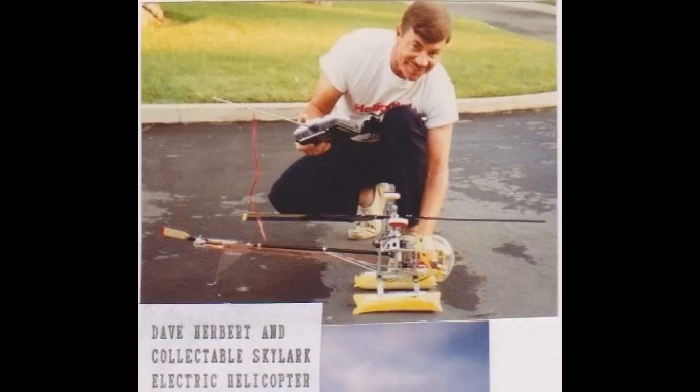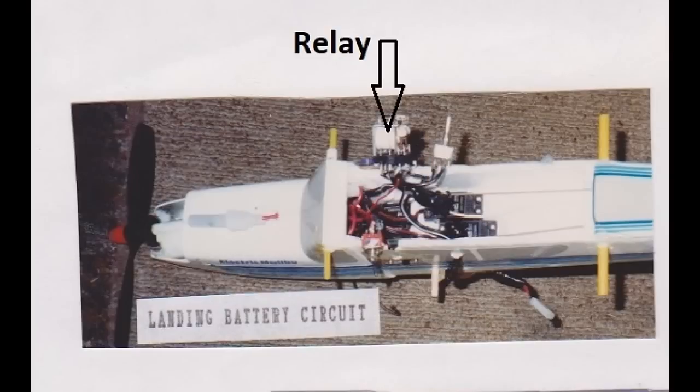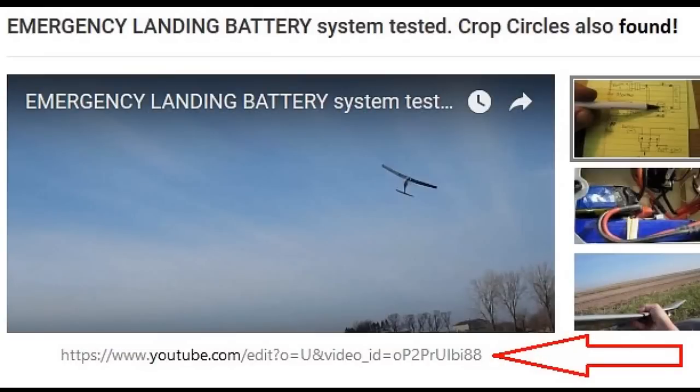In this article I was working on a battery backup for electric helicopters for their main motor batteries. I used a relay to do the backup — it was really great. As soon as the first battery got low, the relay coil energized by that battery became low enough to release and switch to the smaller backup battery, giving the pilot plenty of time to land safely. Later I made a simpler one demonstrated on my RQ-11 Raven using a servo with a switch so I could switch manually to the second battery from the transmitter.